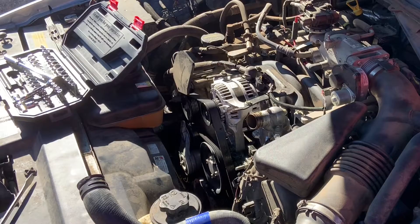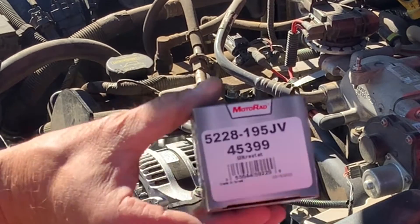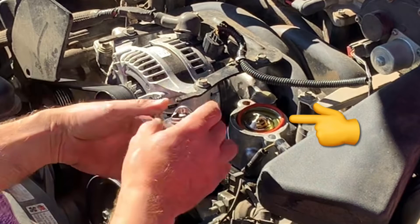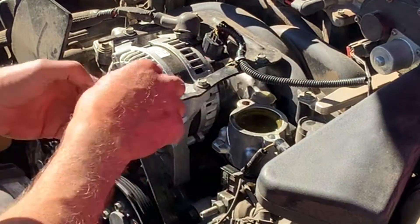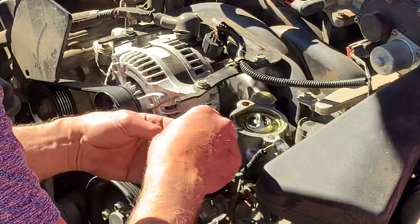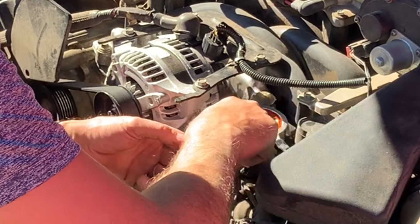Here are the part numbers for the seal and thermostat — I got these from Advanced Auto Parts. The faulty thermostat that was just replaced came from a penny-pincher store. One thing to be super careful of is the orientation of the thermostat. It must go in the right direction or the engine will immediately overheat. Some thermostats also have a notched area that has to fit a specific location, so always verify correct orientation before reinstalling the housing.